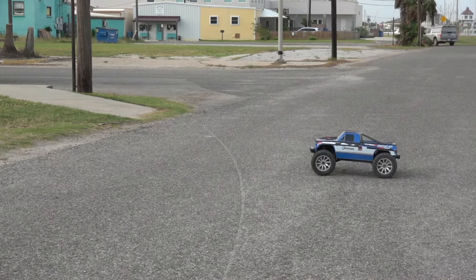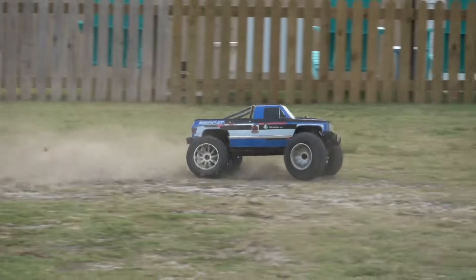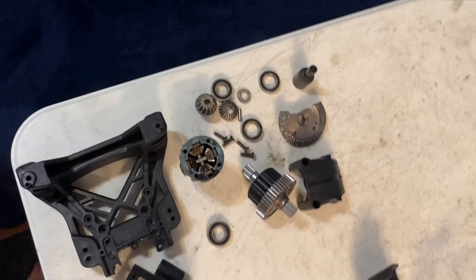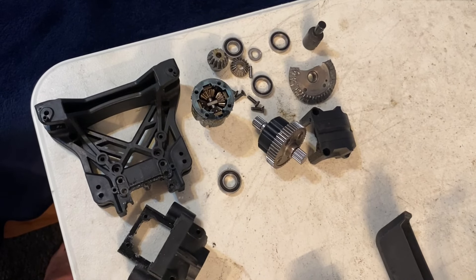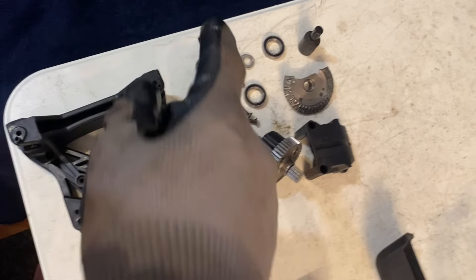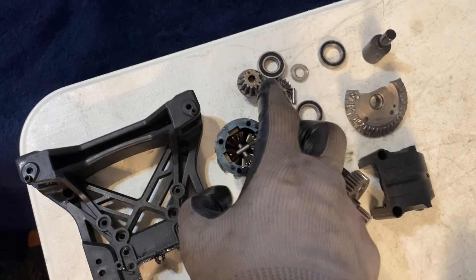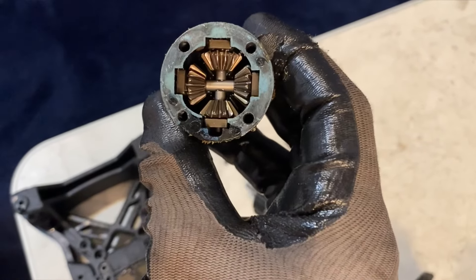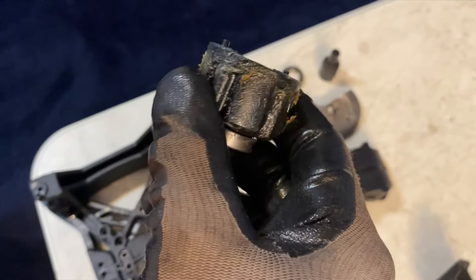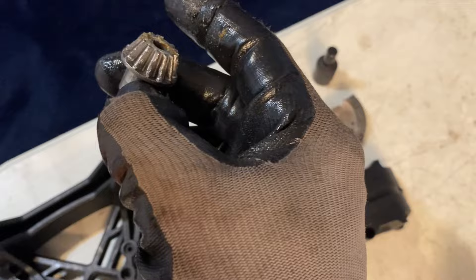It felt like a ring gear or something. Alright everybody, I've got the Vigilante torn apart. That was quite a bash and as you can see, a few parts are broken. The rear ring gear differential just exploded like shrapnel. Good news is the planetaries inside are good — didn't tear those up. Ripped the gasket off; I think the housing is still good. The ring pinion — yeah, it's shot.